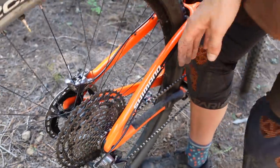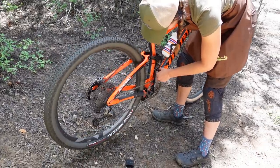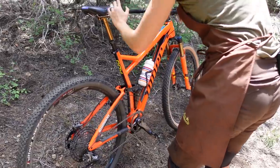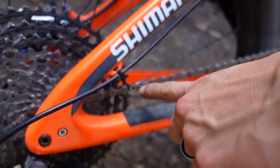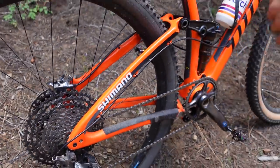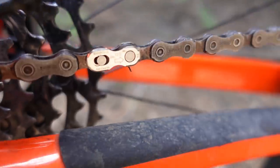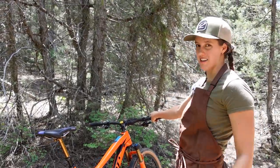There we go. We're going to back pedal, put the pedal right here, and grab the rear brake. As you can see, our chain link is there but it is not connected yet — do not ride away like this, it will probably drop right off the chainring. Now step on the pedal with the rear brake on. Voila! Aren't you glad you have a quick link?